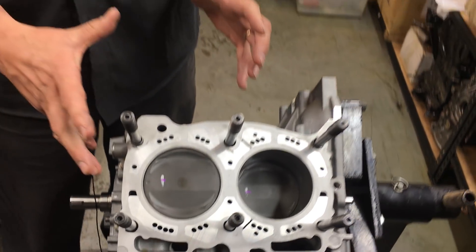When all this goes back together, it's going to be a lot tougher and a lot more durable. We can put the original heads back on — which are the early model GC8 heads, a really good head on those engines — and this is a non-variable cam engine. We'll put it all back together and show you what it looks like and what to expect. This is a really good example of what you need to know if you're comparing different designs — old school versus new school and anything in between.